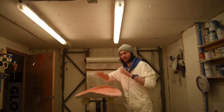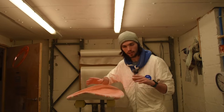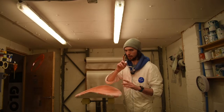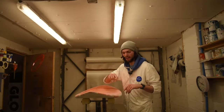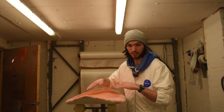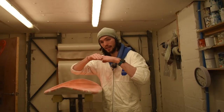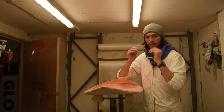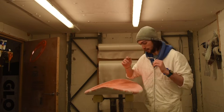It's been a couple of days but I can finally come back to working on this. I've done a bit of prep work — it's a secret. What I've done is sanded the lap line. Fiberglass is naturally bumpy, so you sand it down nice and flat, then put the tape on top of the flat surface and it stops any bleeds going underneath the tape line. You end up with a really crisp line all the way through. Top secret tip for doing good cutlaps.